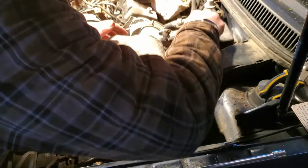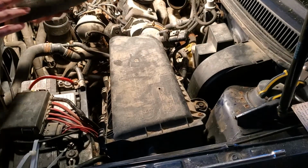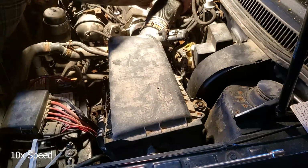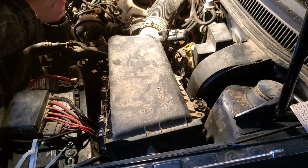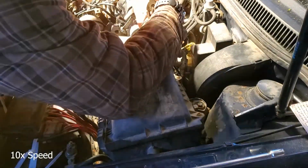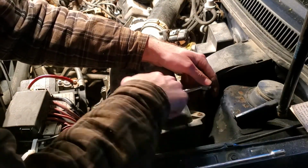Plug back on our mass airflow plug there. Pull this out of here. Okay, put our intake tube back on, which has to go like that, I think. Actually, there's a little notch. I don't know about the airbox, but there's a little notch on the intake tube, and there's a little notch on this accordion pipe, and I guess you just line them up. Gives you the right position for the pipe to sit. Bend looks okay to get to the intake. So I'll just snug up this bolt holding the airbox in.